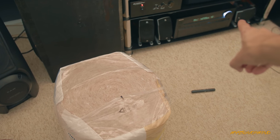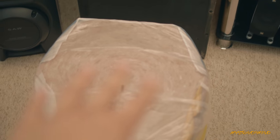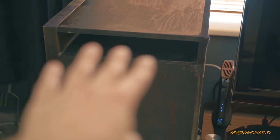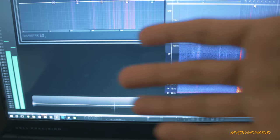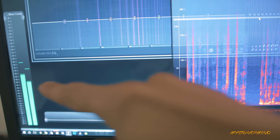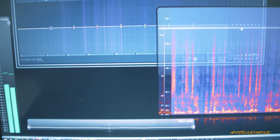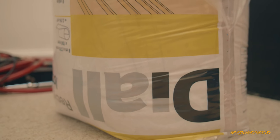These speakers here and that one over there are not connected to my AV receiver. That is the center speaker right there. Now, if you're just trying to get loud with a sub box, then you don't need to do this. But if you're trying to improve the quality of the bass that comes out of one, then this helps. What I have here is my laptop, the audio interface, and the microphone. So once again, we are back with the laptop and all this set up. This is FL Studio, and this right here is going to tell me the volume levels of each frequency that I test. What I'm going to do is test some frequencies, write what they were before I put the stuffing into the box, and compare them with what they are afterwards. Then I'm going to put some of this into the box and retest those bass notes to see what the results are.